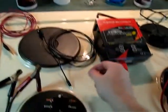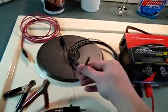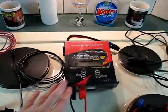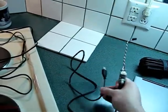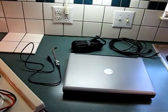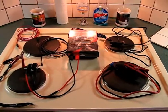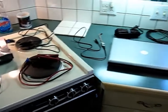Actually, one cell in the pack while I'm driving. I'm going to hook this up with these 14-gauge wires that run all the way into the engine compartment — they have little eyelets on them. This unit will be in the passenger compartment where I can monitor it and look at the screen. Most importantly, I'll be hooking it up with its USB adapter that plugs right into the PowerLab and into USB on a laptop, so I can actually monitor and record everything going on with that cell. It's just the voltage — I won't see the amps going through it since the PowerLab isn't doing anything other than watching the voltage go by. But I can graph it and have nice data files to analyze later.